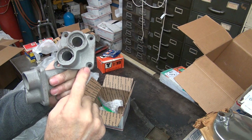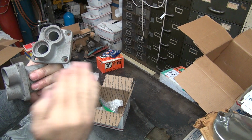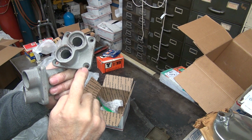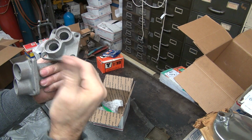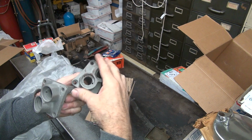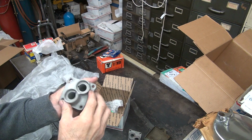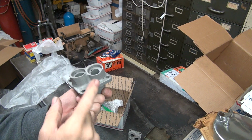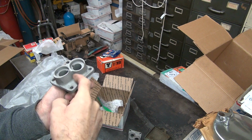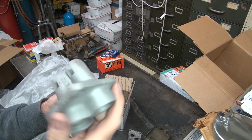This one here took either the flathead, well, they're actually an oval head, straight slot screw, Phillips, or the 12-point weird looking bolt thing that went in there with a countersink. I don't know what year it was. The later stuff had the weird hex head bolts on them. So this is a late 77 through 84 style block, but like I said, we talked about before, this does not have the drain back hole, which is I think 81. So this should be late 77 through 80.